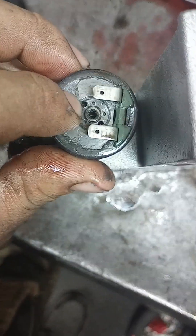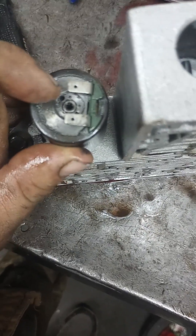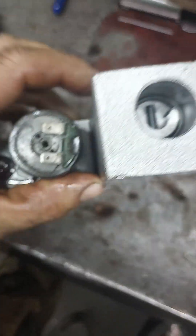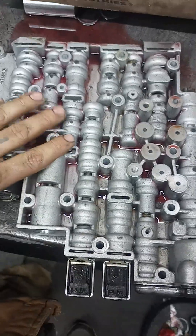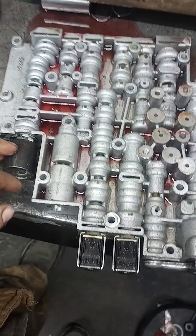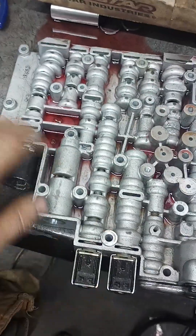You see this little guy right here? Imagine this is a clock. You put a Torx in there and you turn it 10 minutes. That will raise the line pressure in the transmission to about 15 pounds, and that will fix your 2-3 shift flare. When I rebuild these transmissions, I clean these out real good, put new seals on it, and turn it up 10 minutes — and this thing will shift beautiful.